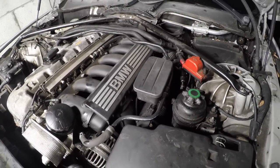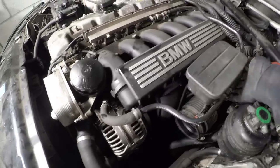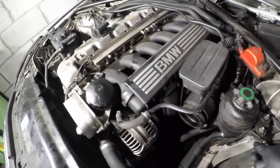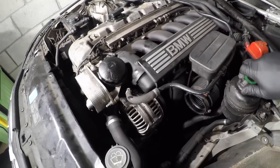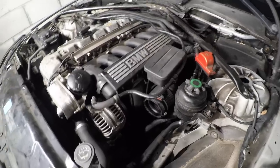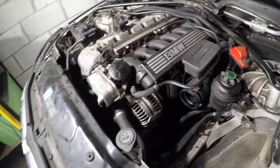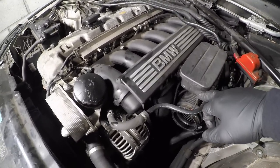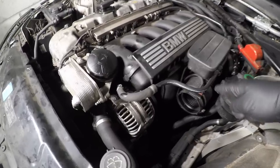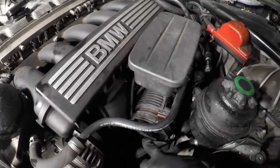The power steering reservoir is in the way. It makes it easier to get to the bolt at the back which sits behind the throttle body. I find it easier if you disconnect these two 10mm bolts and just move the power steering reservoir over — it'll slide, it won't leak, just make sure the cap's tight. Once it's moved you can get your hand behind the back. Use a socket with a long extension and unbolt the jubilee clip with a 6mm socket to get to the hose and pull it off. That will also give you full access to the 10mm bolts for the throttle body. Make sure you disconnect the connector too.